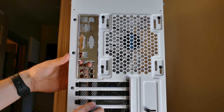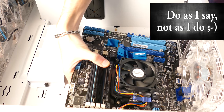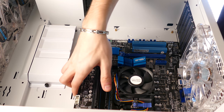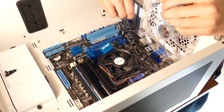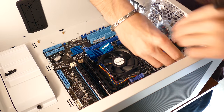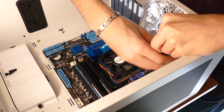You'll see what I mean though. Next, using your CPU cooler as a handle, gently lower your motherboard into the case using both the I/O shield and the included motherboard standoffs as guides. Once it is in place, use the included screws to secure it. Since this is a micro ATX board, we'll only have to worry about six screws. The larger ATX boards will require eight or nine.